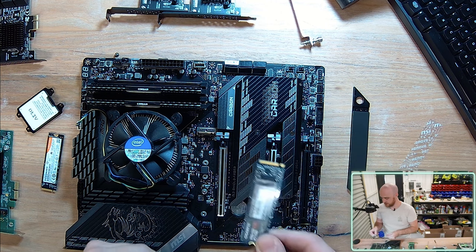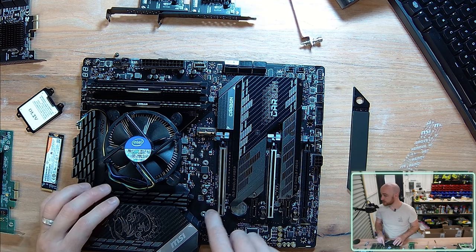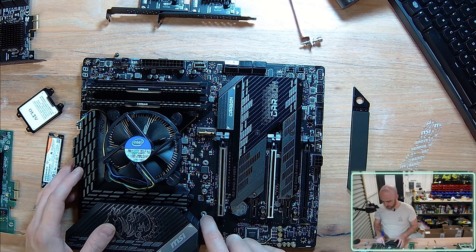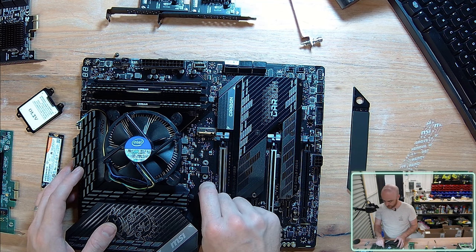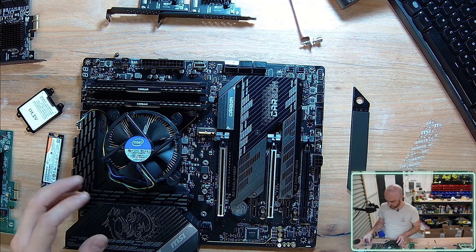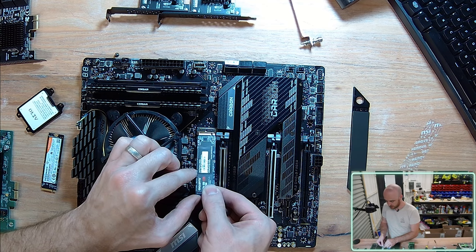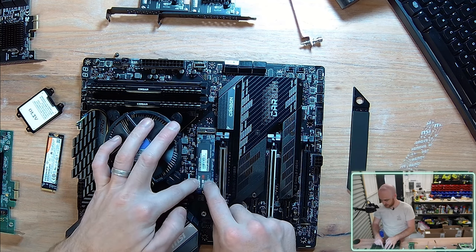So, installing this drive, typically your motherboard comes with multiple screw slots. Or, yes, you can see that, multiple screw provisions for your NVMe drive mounts. I'm not familiar with the longest or the furthest away mount. I haven't seen an NVMe drive that's so large. Just reinstalling that now to this particular position, which is the same length as my NVMe drive. It's apparently going to be a little bit shaky. Place my NVMe drive in, give it that little click. Well, that gave me a satisfying click that time around.